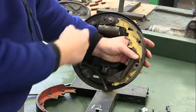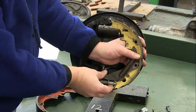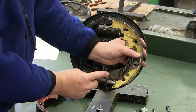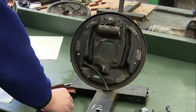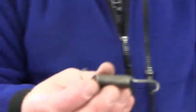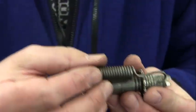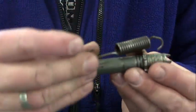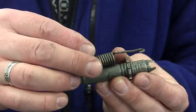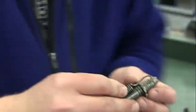The round space goes to the top and the flat side goes in the bottom. Our star wheel has to go on the side of our adjustment lever — they have to come in contact. If they don't come in contact, the brake can't be automatically adjusted, so it's really important that the star wheel is touching the adjustment lever. Then we need to put our spring in the right spot — we don't want the barrel of the spring hitting the star wheel. We need a gap between the spring and the star wheel.